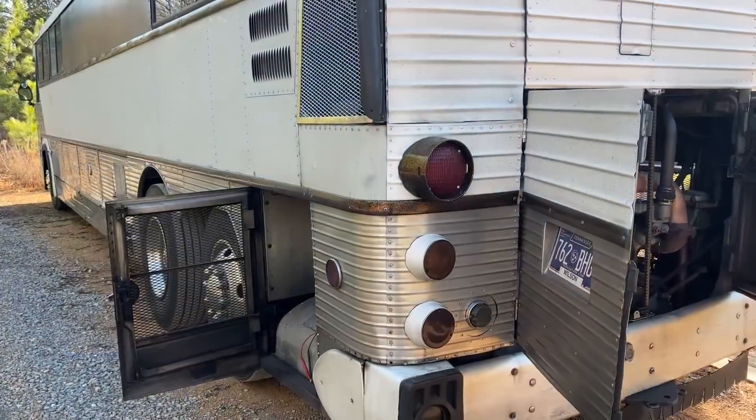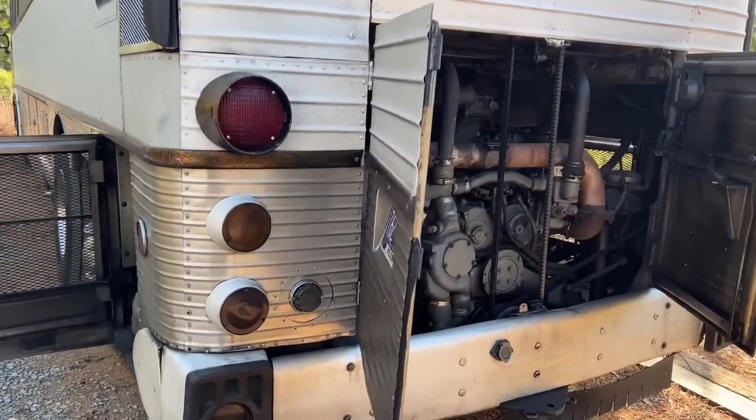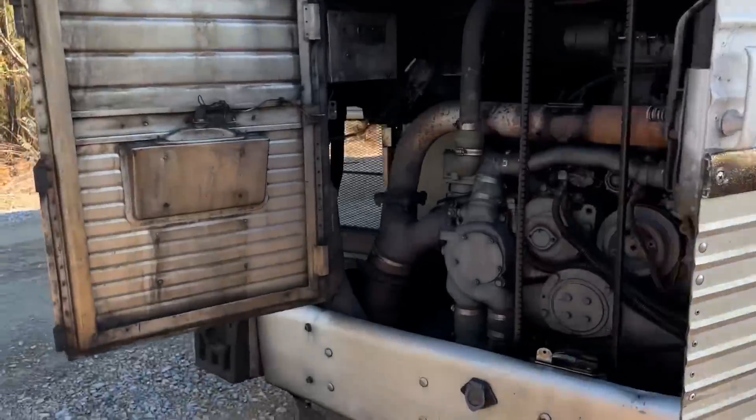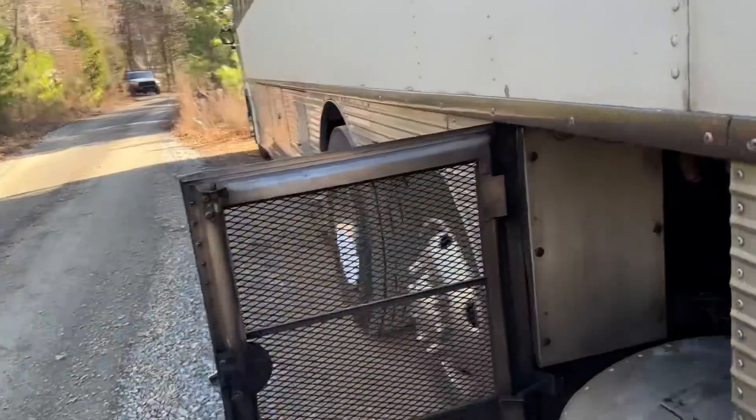Tim's bus just came in for no alternator working. We threw it on the 24 volt charger for now, and the very first thing I went to do was start checking wiring. And this wire, which I think is the field wire I just pulled up, it was stuck on the corner of the alternator — it's chafed through — so I'm guessing maybe that was just grounding out.